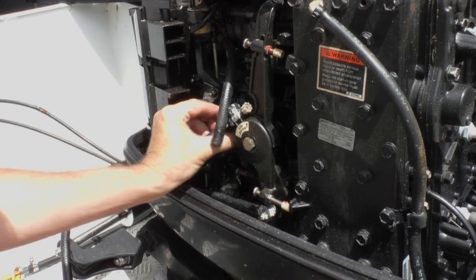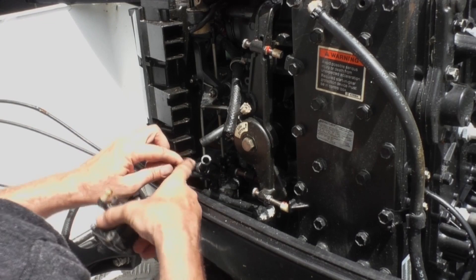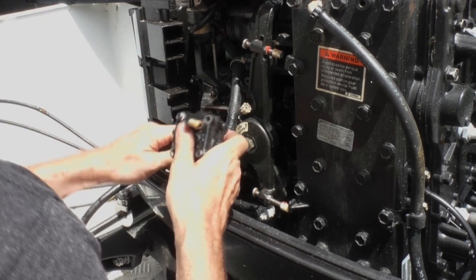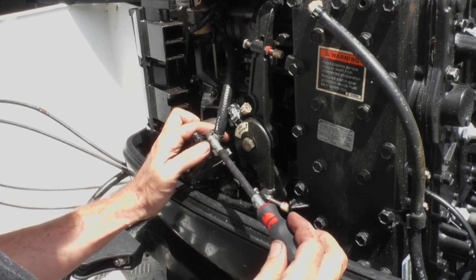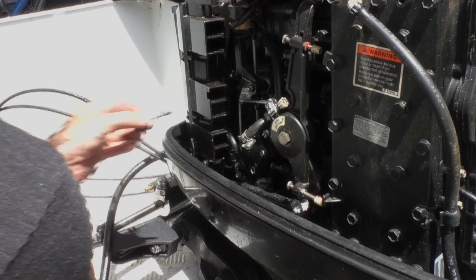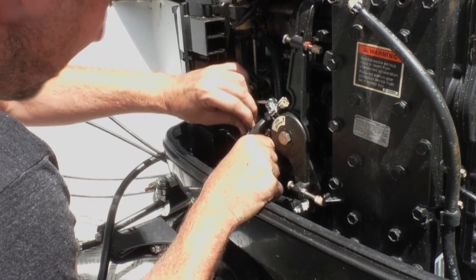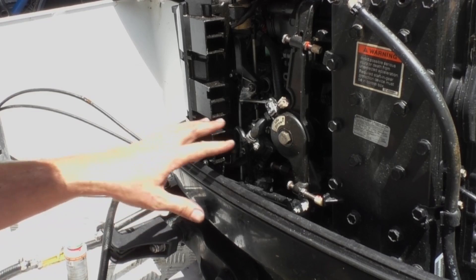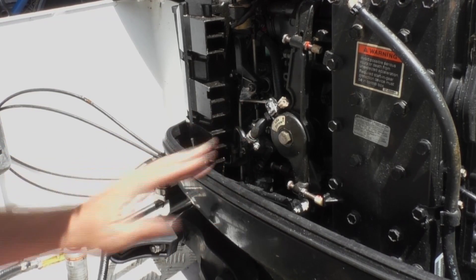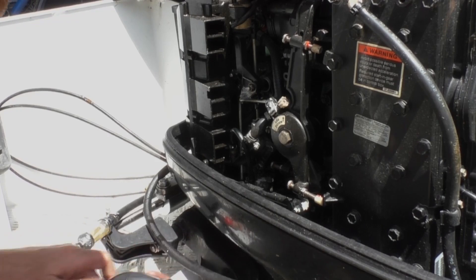I'm going to replace these cable ties that were on here originally with a couple of new hose clamps. I've got the hose clamps onto all the lines — I'll push all the hoses on first and then bolt it back on. All these hose clamps have a 7mm hex head. A little bit of Loctite on the mounting bolts, all hose clamps are tight, the bolts for the fuel pump are tight. I'll prime the bulb a few times to get fuel back into the pump, then fire it up and check for leaks.